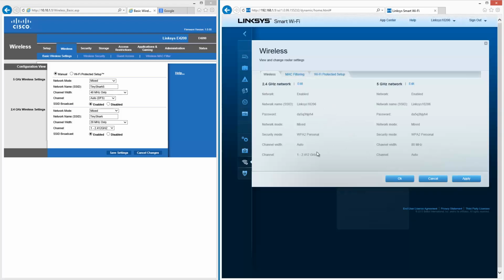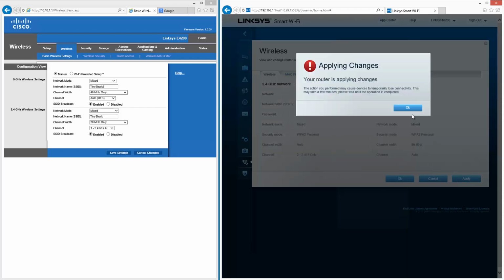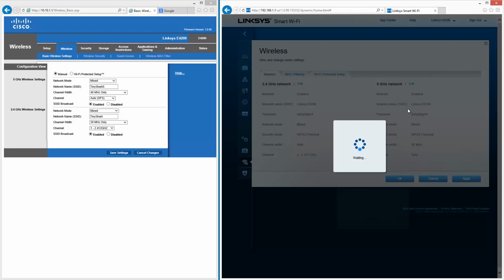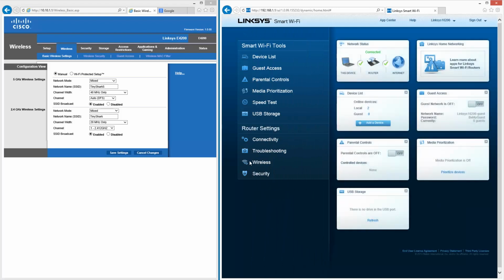Yeah, it's responsive. So all it did was restart the wireless radios functions. So we should be able to go back in and add the 2.4 gigahertz and move it to channel 2, for instance. Nice and quick and easy. I'm going to click Apply this time instead of OK. Same result. It's applying changes. Looking at the device itself, the white light is glowing solid. It was rather fast, wasn't it? Okay. We're done with that little test. After this, I'll probably just reset to factory defaults.